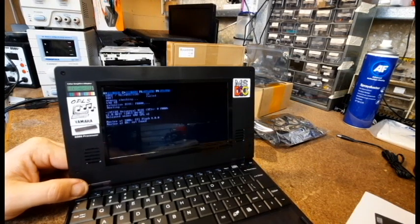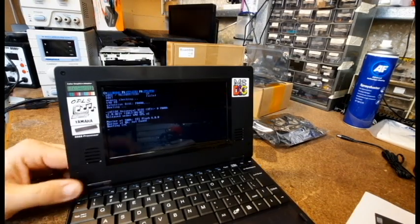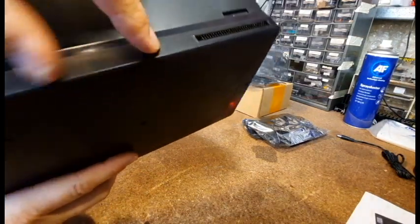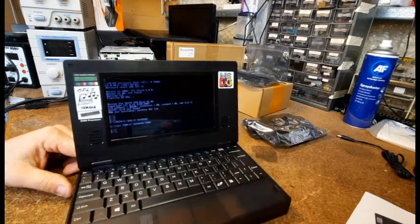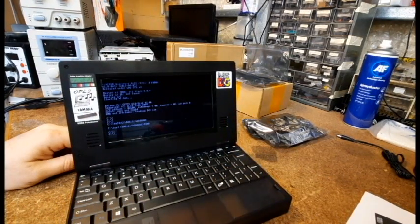Another thing too, while this boots up, I would have liked if it had a floppy controller built in. You can literally get single chip floppy controllers, so it would have been nice to have a port along here with a ribbon cable where you could plug a floppy drive in, or one of those, I don't have one, but you plug a USB drive into it and you have floppy images on it. Gotek, they're called, whatever they're called.